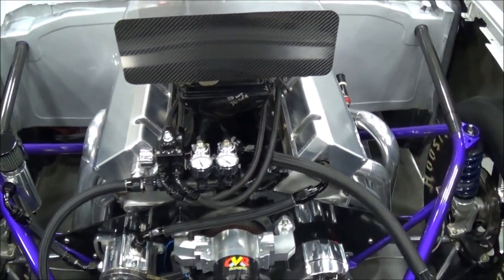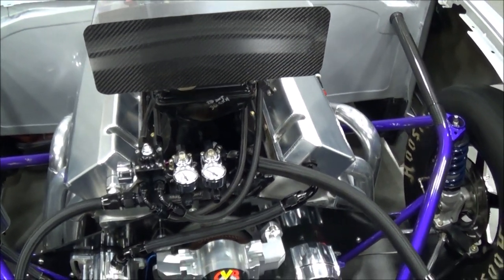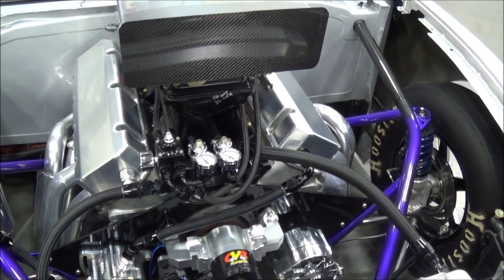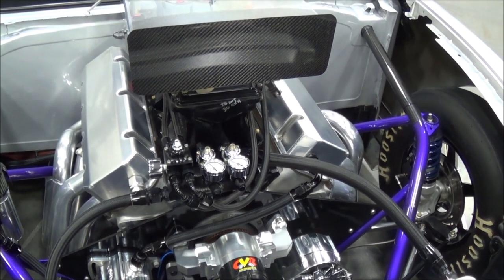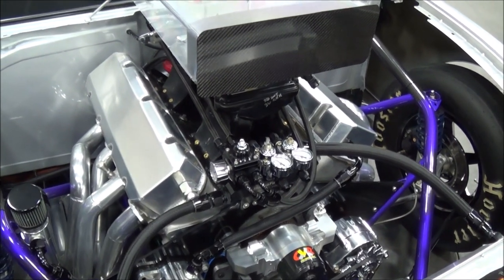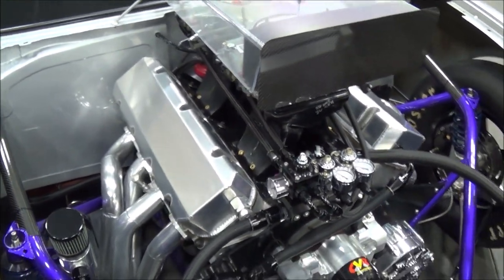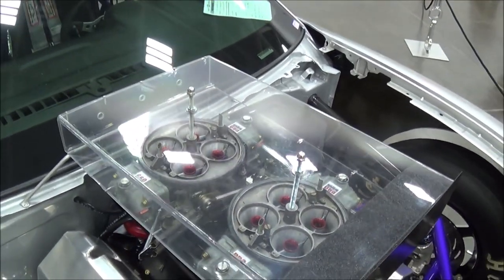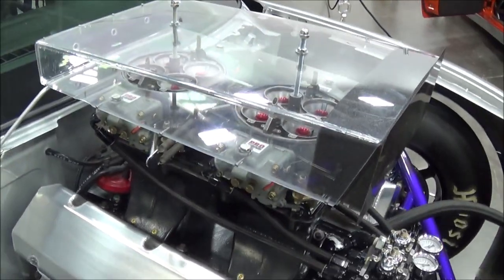Well, I'm no expert, but that's not a V6. What are you running? It is a big block Chevrolet. It's a little bit stroked, bored 4x4 production block motor. It originally is a nitrous motor, but we've been making some changes. But it is converted. We run it on E85 now. What about the carburation? It is two 1050 Dominators built by Pro Systems to run on E85.